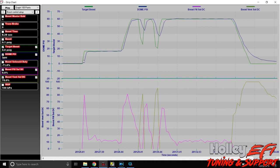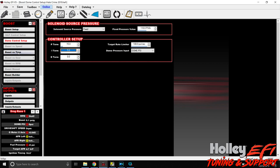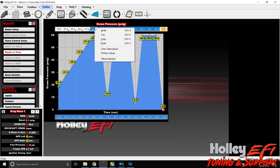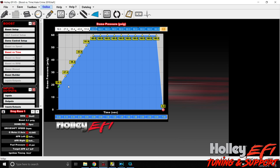With P=15, I=5, D=0, that looks pretty good. Some of you are going to look and say it didn't follow exactly right - well look at our time count here. This is less than a second from start to finish, maybe five data points behind. Now we're going to put a more realistic boost curve in - going to boost versus time, left-click and drag to 0.8 seconds, right-click fill row values, highlight all at 60 pounds and fill row values. That's a pretty common boost curve for a small-block single-turbo setup on a good track.